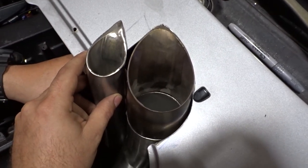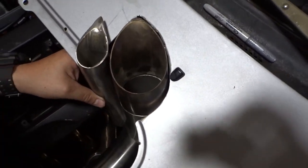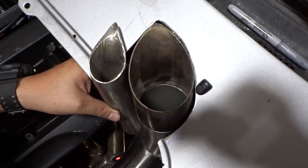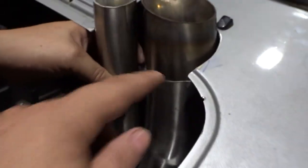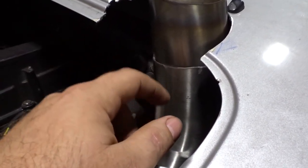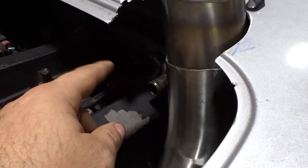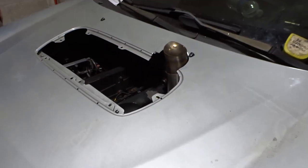Good thing I don't have to cut the hood. I like how it looks — look at it from the camera view, it looks nice, right? This one is just tacked in place. We're going to go ahead on the other side and weld it completely with a teardrop. Then we can just do our wastegate pipe. Let's get to welding.